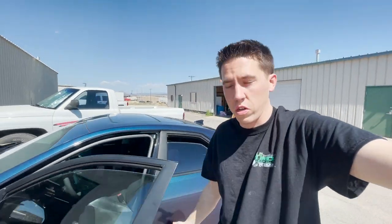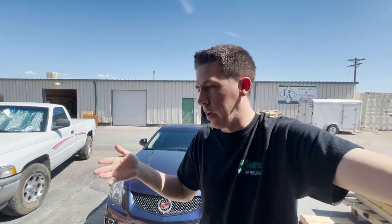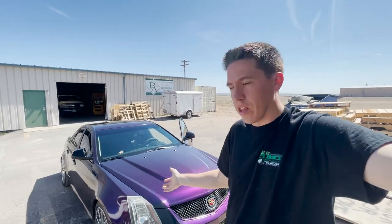The tune that's currently in it doesn't look too bad. It looks like they modified everything pretty decent, but you never know until you get it on the dyno and make pulls looking at air fuel and knock. He said he wants to make sure everything is good with it. I did have to fight with HP Tuners website a little bit this morning. Finally got in and got some credits — it's $100 to unlock the ECU and TCM on a car like this. The car doesn't have a cam, but it does have an upper pulley and an intake.